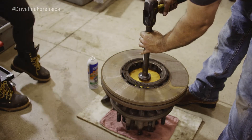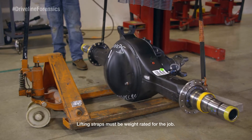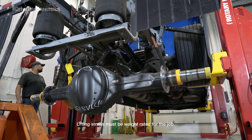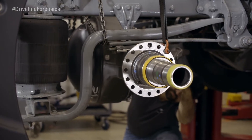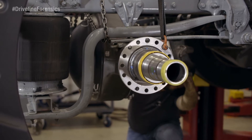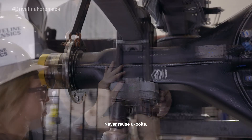Do that on both sides. Now we're gonna maneuver the new axle assembly under the vehicle and secure the lifting straps. When that's secure, set all tilt wedges on the housing and start lifting it into place against the spring surface. Now hang the U-bolt and snug down the nuts.